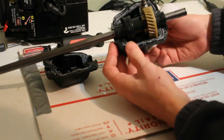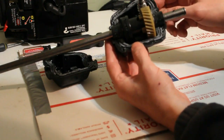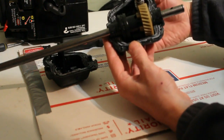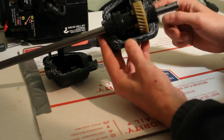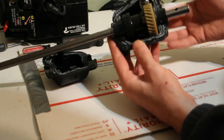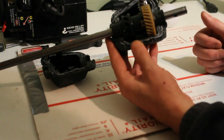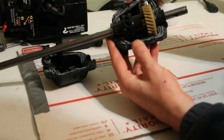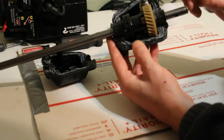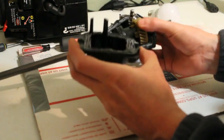I wanted to show the basic operation. When the belt - connected to the shaft of your motor - and you pull the handle, this turns the transmission unit and tightens the belt where it comes in contact with this pulley. You can see the shaft turning. When it's turned the opposite way - presumably if you're backing up the mower - this interlocking gear spins the opposite way and will not turn the shaft. But if it turns the other way, it engages the shaft. That's the basic operation of this transmission - nothing too fancy.